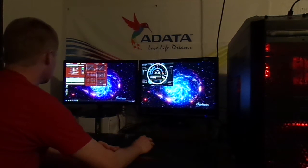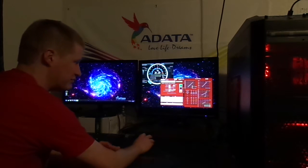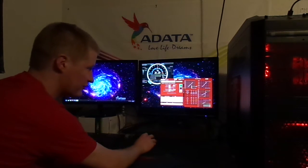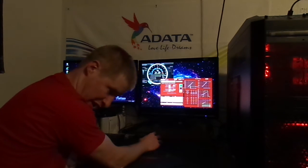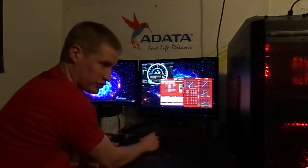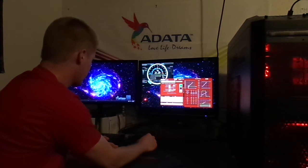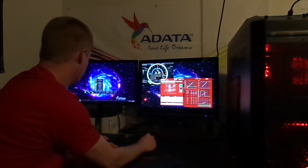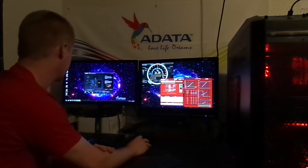So OCCT has us running around 37 degrees Celsius, 4214 megahertz, 241 megahertz front side bus. CPU V-core, according to the Asus BIOS, is 1.425 volts. Our Turbo V Evo, we'll look at DigiPlus power control so you can see what I have for the current settings.